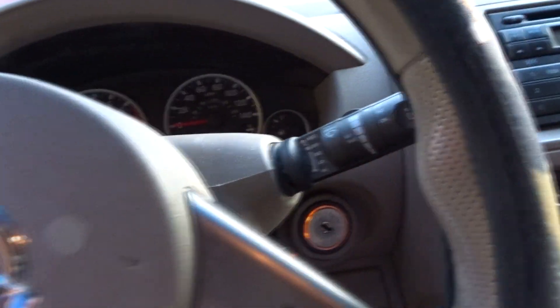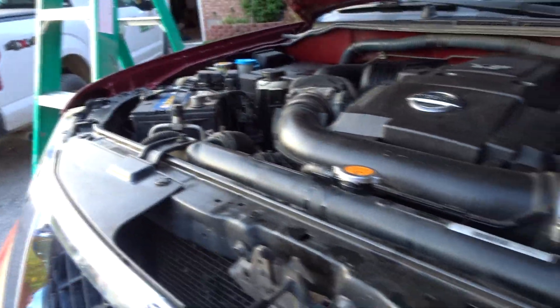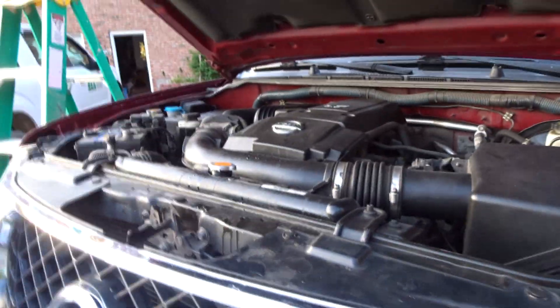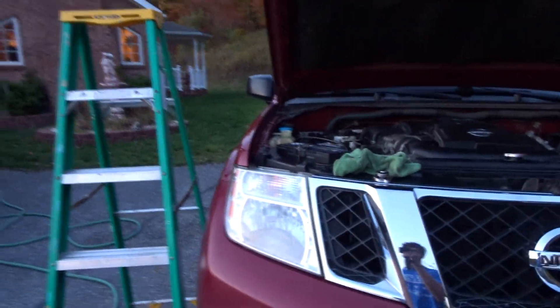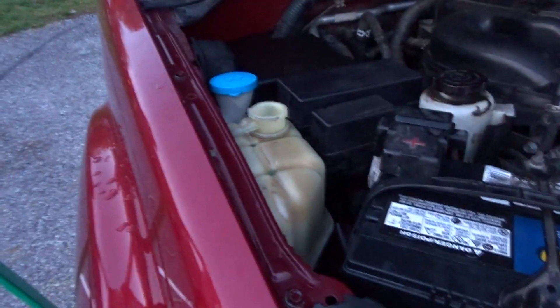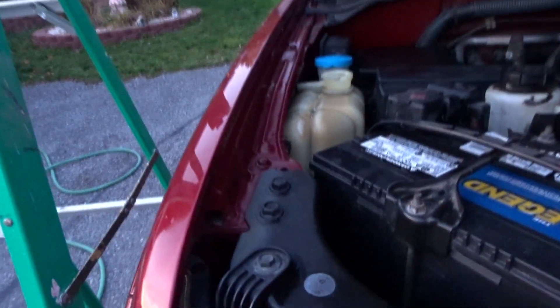Running the vehicle for a minute, you're going to want to shut it off, then probably let it cool off for a little bit before you open the radiator cap. Let it cool off because it was obviously full, so it might spill over. For a minute, this used to be full to the very top and now it's down to about here — so you do want to fill both up the whole way. It'll make sure you have enough coolant in the engine and heater core. We overfilled it, so now we're going to run it without the cap on to make sure it's not going to overflow. This gets all the air out of the system by leaving the cap off, which will make it perfect.